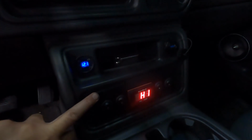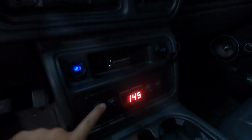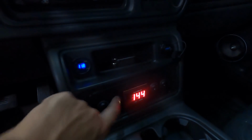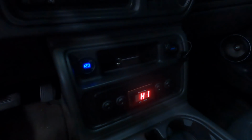So a guy named Derek Gingerich, I believe is his name. I'm sure I butchered his name again. He makes these little panels for various places on these trucks. I use the USB bulkhead. I've got one USB cable that runs over here to my FuelTech, and then all I got to do is plug a cable into here, and I can start tuning my FuelTech, get the data logs, etc. This one is actually for my Nitrous Express Max 5 nitrous controller. I don't have it installed yet, but this is where I'll plug into it to tune it whenever it's time for that. Derek also made this little panel here. It houses 4 switches and my wideband controller for the FuelTech. So this switch here is my electric fan for the motor. This one right here is my water pump for the air to water intercooler system. So that's that.